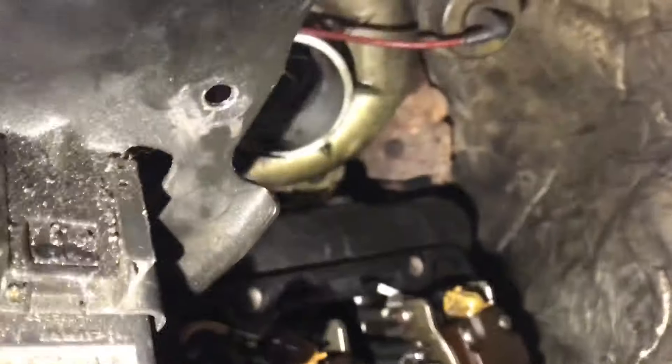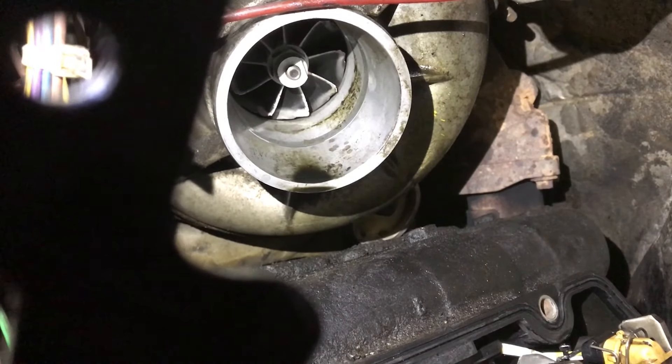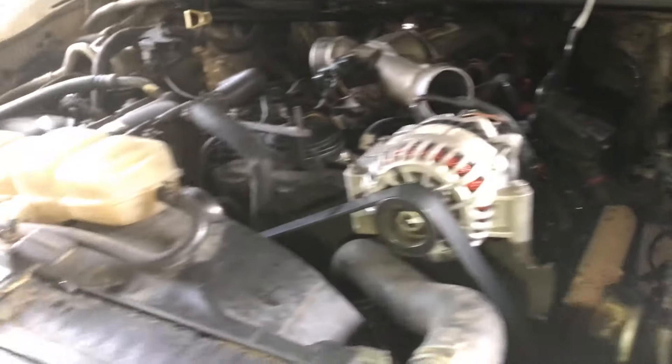Another thing — if you're ever having these valve covers checked — you want to pull and check your actual turbo compressor wheel. The previous owner never seemed to change the air filter, and there's a lot of buildup. I'm advising the customer to replace it or have me rebuild it, one of the two. Thanks for watching.